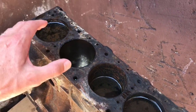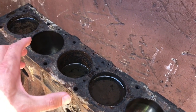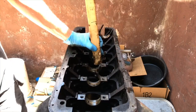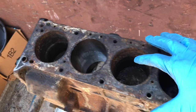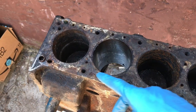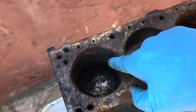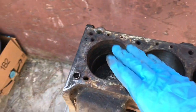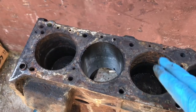Now we're at day four. What we're going to do is drain these cylinders of the Metal Rescue and see if we can tap a little bit more on the pistons to get them to move. We got these pistons all loosened up — we had to do some flipping and bashing with a two-by-four and a soft blow hammer, but we got them down. Now we want to scrape away these high points of the rust to make it a little smoother so those pistons can come right out. We'll use a jackknife to scrape away some of those high points.